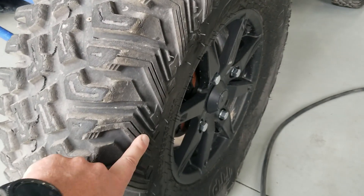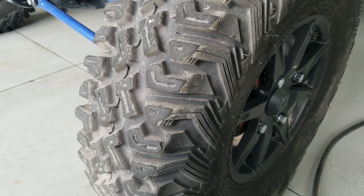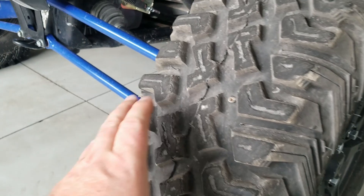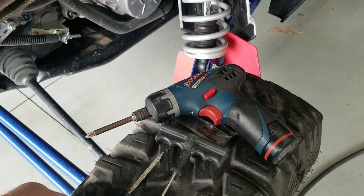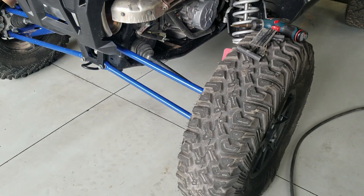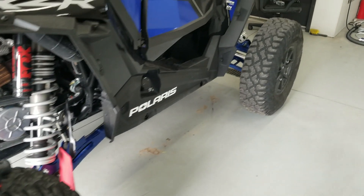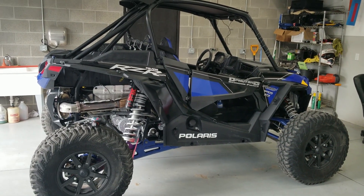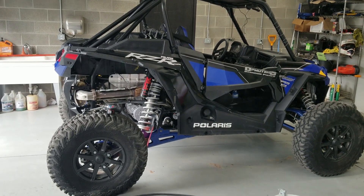That's why that is in my tool kit. I've even had holes on the sidewall — which you're not necessarily supposed to use a plug for — where I've stuffed three plugs in to get it home, and they just work. Plugs are pretty amazing. If you want, when you get back you can throw a patch on the inside, but I've never really had to worry about it. Anyway, I picked up a screw — I'm just gonna go through the process of what to do to fix it and how easy it is. The ITP tires have been badass, the turbo S has been badass, really enjoyed using this machine. I'm excited to get it up in the hills.